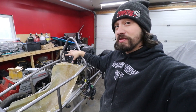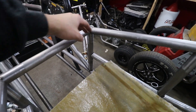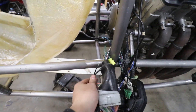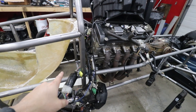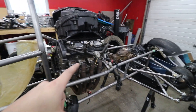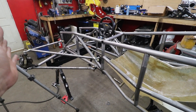We got the seat in place with self-tapping screws and it actually feels really, really nice. I'm probably going to end up fixing this bar - cut it off and build a bar that goes up because it doesn't give you enough knee room to press the brake pedal really hard - but we needed to mount the seat so we can figure out the space we have back here to order a fuel tank that fits behind the seat, which was our next biggest obstacle. We get rid of this fuel tank, put it down there, get the dash wired up to the front, get the drivetrain going. I need suggestions on an affordable set of shocks for our cantilever suspension, and wheel suggestions - 15 inches, probably 15 by 8, 4 by 100. That's it for me today - tell me what you liked about this video or what you'd like to see next. Have a good week, peace!